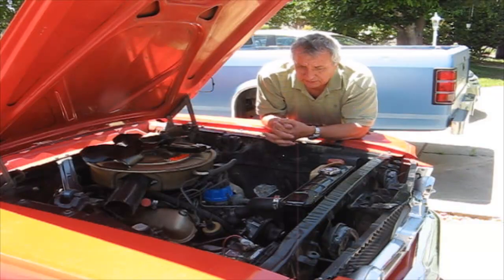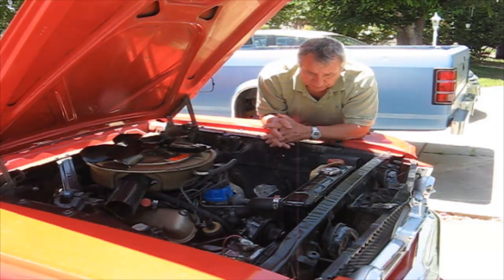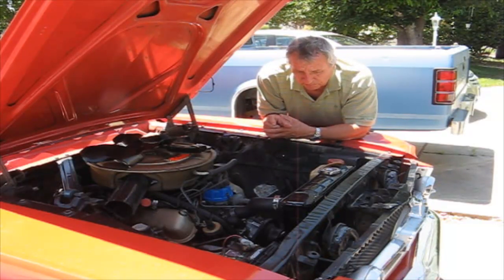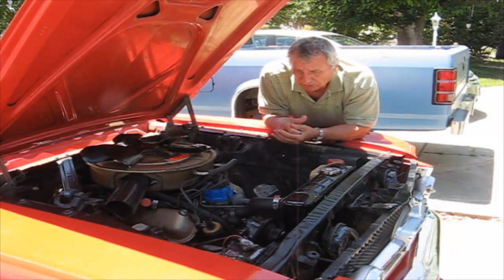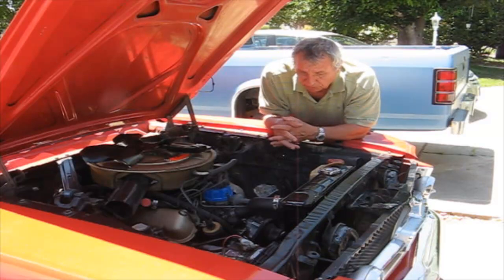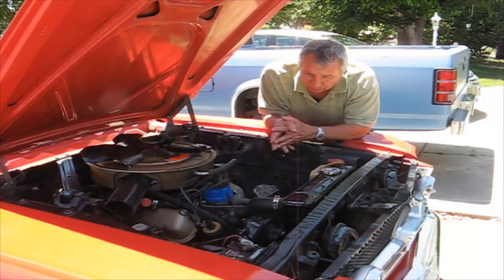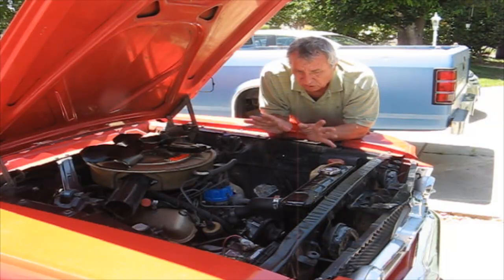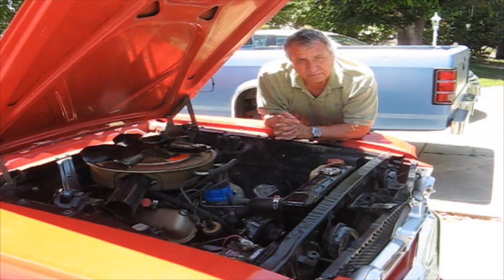So then my next thing, I thought the water pump was bad. So I replaced the water pump, and when I replaced it, I found that one of the inlets, the top inlet on the water pump, was broken. So I'm assuming that water came out of that broken inlet and caused the leaking. So I solved all that, and it still runs warm, not all the time.